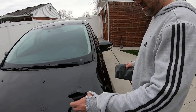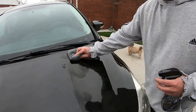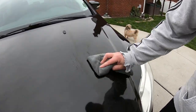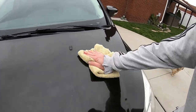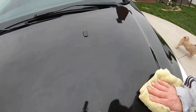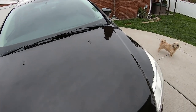They say you don't have to use a lot — a couple squirts should be good. We're gonna do some small squirts on here, spread it out evenly. It says let it haze up and it's going to give you a little bit more cleaning power and a little bit more filling for any minor imperfections. It spreads pretty good — you could go in circular motions too, whatever you prefer. We'll let it haze up and then take it off. That comes out pretty good when you let it haze up a little bit. Looks good — we're gonna do the whole car and let it sit for about an hour.